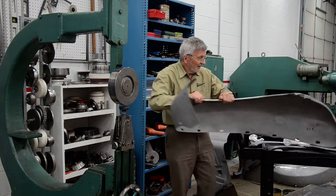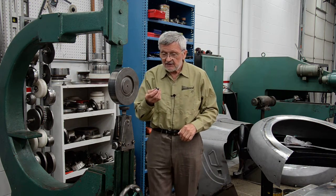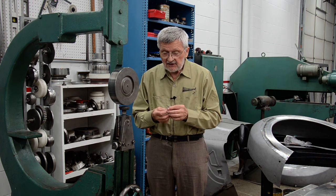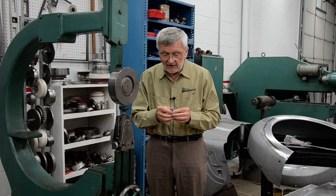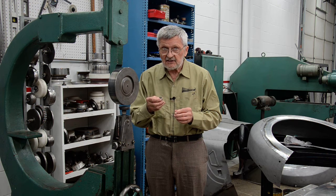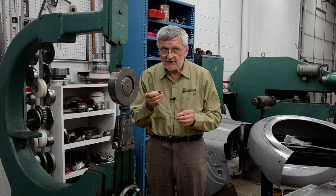What's left is this one — the die with the file blade. Twisting metal is very difficult. I fixed many frames and unit bodies — a few hundred of them in a collision shop — so I learned that twisting metal is very, very difficult. If you have a flat panel, an oil can, or loose floppy metal, then you can try this. This will shrink by twist. I'm not going to twist a lot — if it twists half a degree or one degree, that's plenty, that's all you need. And it will stiffen up the panel. The twisting is so little it's almost invisible.